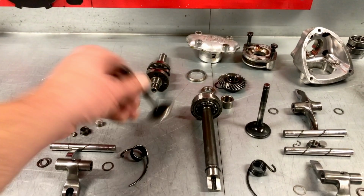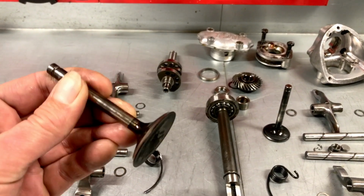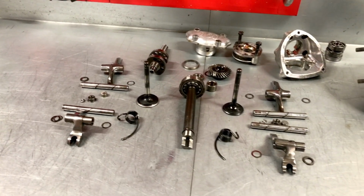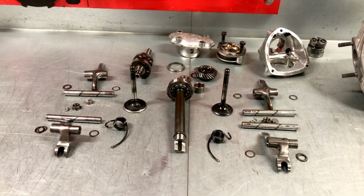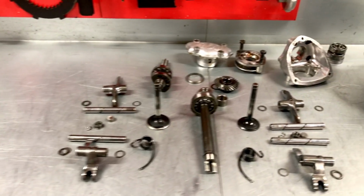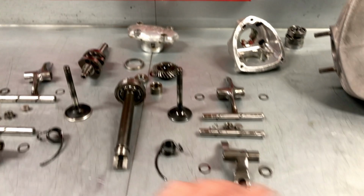Well, the valves, we're going to replace, as we always replace them. They are good to go, in fact, but well, if we're doing all these efforts to rebuild the engine in this way, let's fit new valves into new guides, as we can discuss later on. And well, you saw struggling with it, and let's move it a little forward.